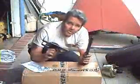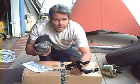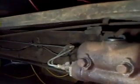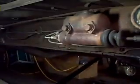So we'll go ahead and paint these up along with our master cylinder. While everything's drying, we'll take the old one out. It goes a little like this. Okay, so here's your old master cylinder. We've got our brake lines attached to the back. We're going to go ahead and start and take those off first. Get a rag, because when you do, all the brake fluid will start leaking out. So get a rag and a bottle, catch all that stuff.